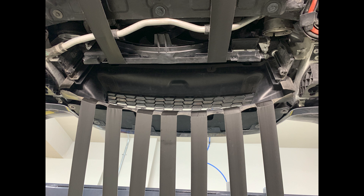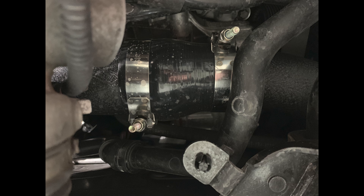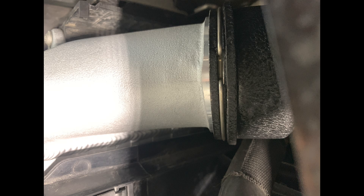If you don't have a lift or a friend to help with this, you might need to remove the bumper liner. It wasn't immediately obvious to me how to remove it, so I decided to leave it in place, but it might not be that difficult to remove. The new intercooler outlet wasn't in the exact position of the OEM one, so I had to loosen the coupler for my charge pipe because it's a two-piece charge pipe, and then I could pull the bottom half closer to get it mated up to the new intercooler outlet. Just make sure you re-tighten this clamp after you get the other end connected to the intercooler — I forgot and replaced all the skid plates until I noticed. Yeah, that sucked. You have to be patient to be stupid.